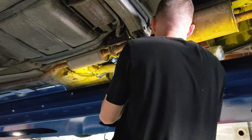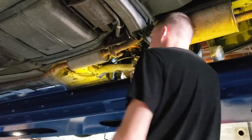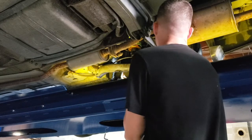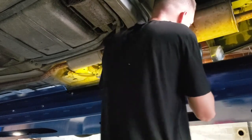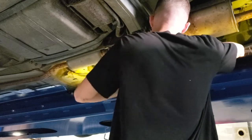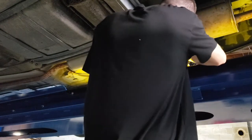If your left and right camber are both off — say you've got negative two degrees in the front — but it's the same on the left and right side, you're not really going to get drivability issues. You're just going to get tire wear on the inner part of the tires. The trouble is when it's different left to right — that's called cross camber or cross caster. If I've got negative two degrees on the left and zero on the right, the car is going to want to pull to the right really severely. Same way with caster — if left and right are the same it'll generally go straight, but if one side is extremely different you're going to have a pull issue.